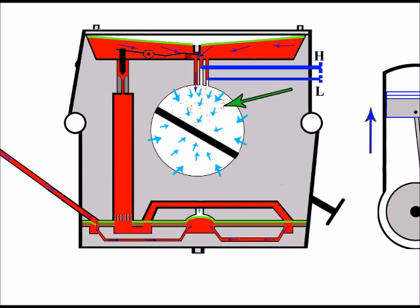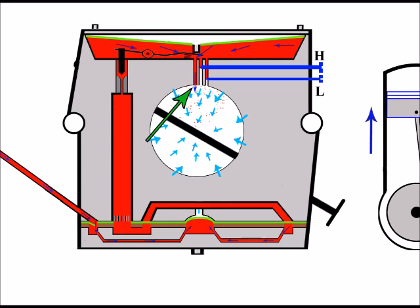And now we're left with an insufficient air to fuel mixture ratio. The main jet itself is still open, and it's allowing some fuel to come through, but it wouldn't be enough to allow the engine to run at full speed. So this could be a classic example where an engine would run at low or idling speed, but as soon as we pull the throttle, it does the bog down, the aww, because we haven't got enough fuel there to support a high revving engine, but we could support a low revving engine possibly.